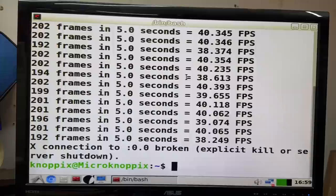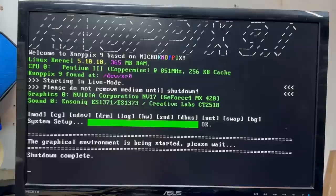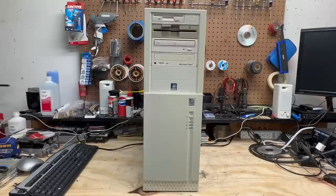Initiating shutdown sequence — and there's the shutdown sound. Apart from that floppy drive being a little broken and getting head-faked by a faulty power supply, this machine is perfectly fine. I really need to build or buy a proper power supply tester — one that'll actually put a load on the power supply, because my current testing methods just aren't cutting it. I need to design my own tester anyway, because I cannot for the life of me find a commercially available AT power supply tester. It seems like they're all centered on ATX. So if you know of any, please let me know in the comments.